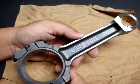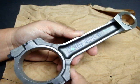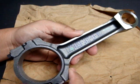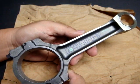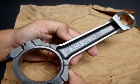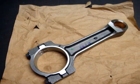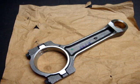Overall, the LSA connecting rod is a very sturdy and durable design, and it is probably capable of supporting up to 600 horsepower, or maybe a little bit more, rather reliably and durably for several 100,000 miles within an LSA engine. For those of you looking to build LSA engines, I would say that the stock LSA connecting rod is actually a very good choice.